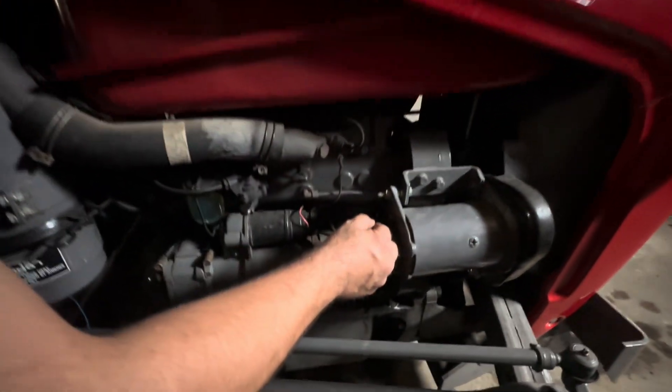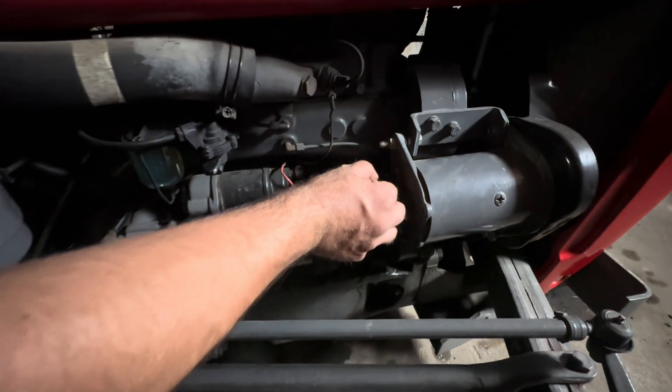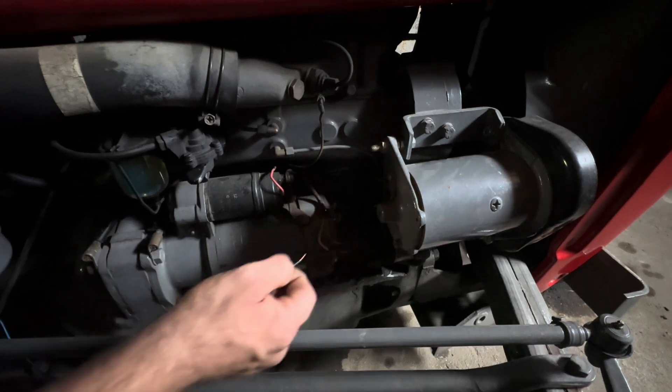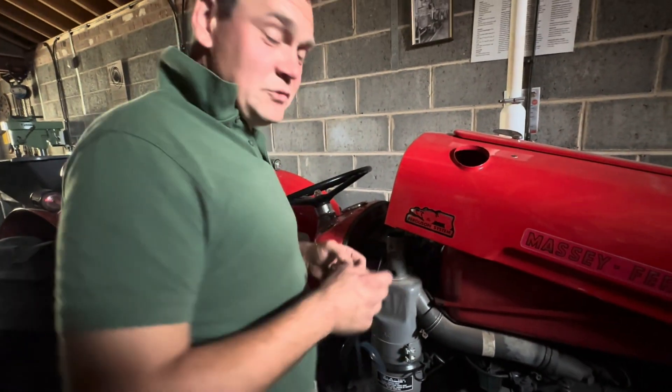Go to the field — you should see a blue spark. See that? That's as much as it needs. Now it's polarized. So if we put these wires back on, we should get a reading on this voltmeter. Simple as that.